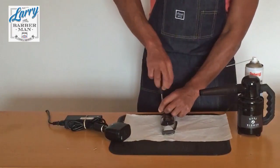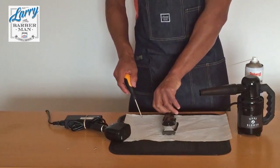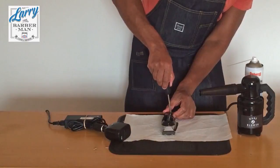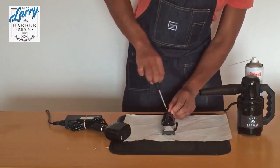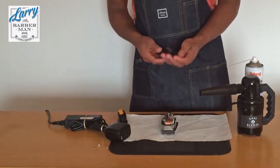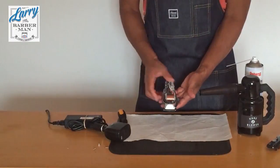With the Wahl Senior you have three screws that you need to take out. There's one screw at the very top and two at the very bottom, which have proven very difficult to get out today. That's the three screws out — then you take the belly off, and obviously because they're grinding very hard down there in Glasgow, these clippers are full up with hair.